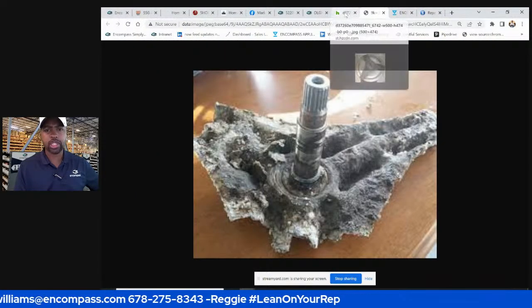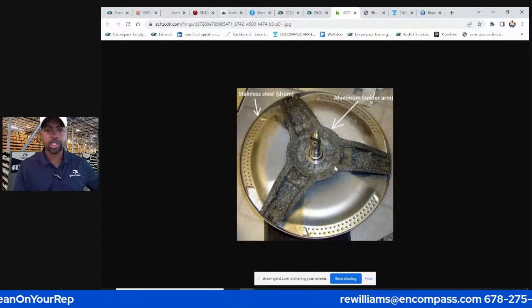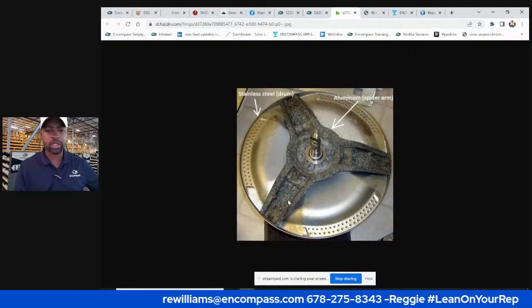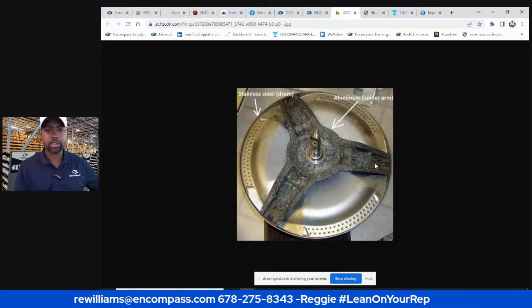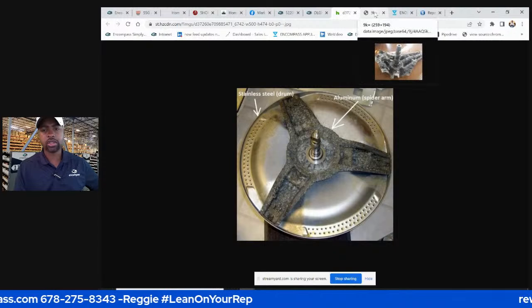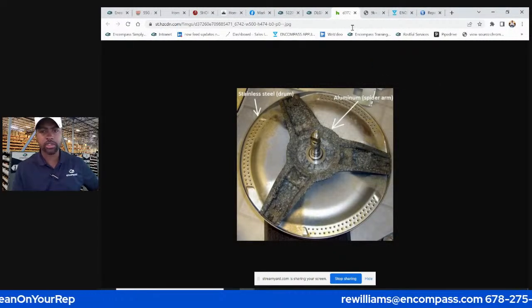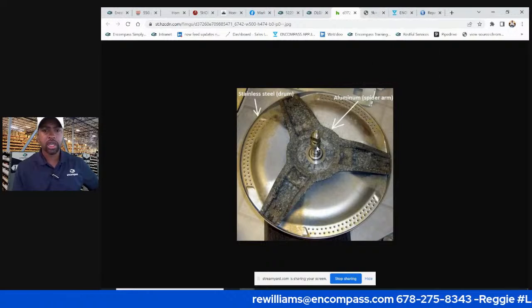This is an illustration I meant to show during the washer. I just had this in the wrong spot. So in the washers, right? Now, I've rarely ever seen a bad bearing in an LG washer. Some Samsungs had issues with the bearing being corroded. They say the enzymes in the detergent do it. There's animal fats in the detergent.